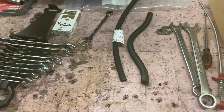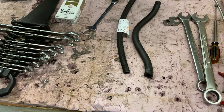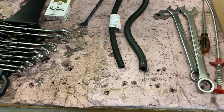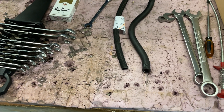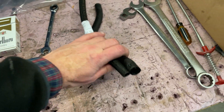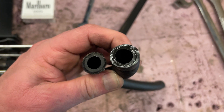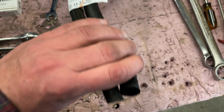Good afternoon — a short update. We got the new rebuilt 1984 model year hydraulic pump in the car, and I replaced the low pressure fuel hose. You can see on the right this is what I had in there, and on the left that's the one from Mercedes-Benz.